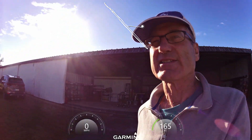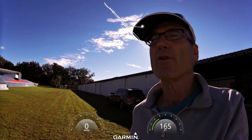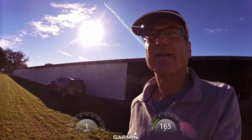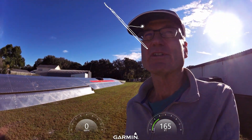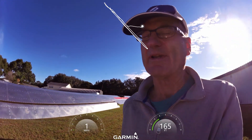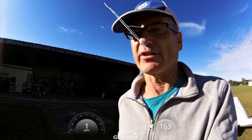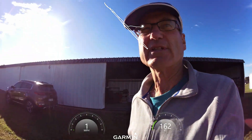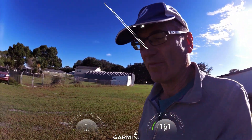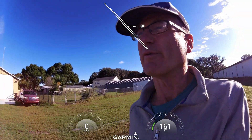Just kind of let it settle in, and that means it's going to fly. It was all the way up to 50 miles an hour in a hurry, even 60, and I wasn't even using full power. But when I cut the power it just stayed there and floated a lot. So that tells me my L over D is going to be excellent, just as predicted. Clearly I was flying at less RPMs on the Polini 250, which is installed here, than with the short wing, which took a lot more power to stay in the air and came down right away when you cut the power.